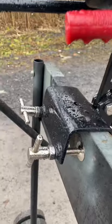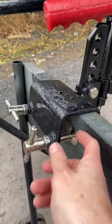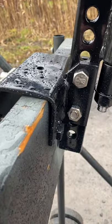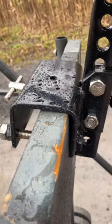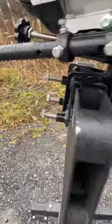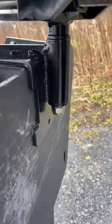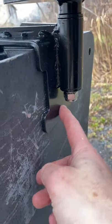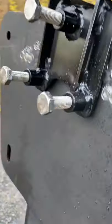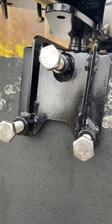The SD300 uses a two-point wing bolt transom system — you tighten down these two bolts on your transom, and you may need to add material if your transom is thin. You could also put a bolt directly through your entire transom. The 13 light uses three points, and the transom is a little different — it's got reinforced ribs for added strength. You can also drive a stainless bolt or screw directly through your transom, and there's a cutout in case you want to mount the kit on a boat that has a centerline rib.